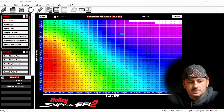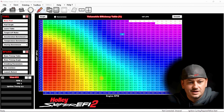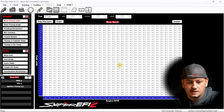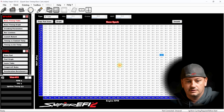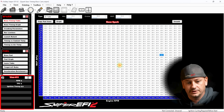The first thing we're going to look at is basically me explaining what I'm talking about. If you go into our ignition table — I've made up some imaginary examples just to paint the picture — you can see the entire ignition table is at 20 degrees. What's happening is guys have a commanded value of 20, but then in their views they can see their actual ignition timing is maybe 18, or 10, or 25 — it doesn't match the actual ignition table.